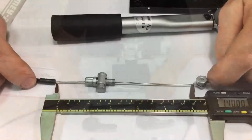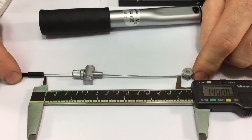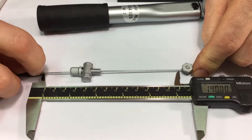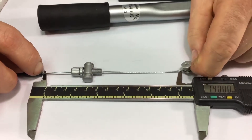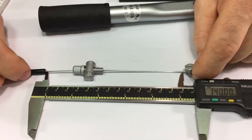For the three-speed, the cable adjustment for the rotary shift three-speeds is 140 millimeters. Measure from the tip of the ferrule, making sure that the ferrules are seated to the inside face of the cable anchor. It should be exactly 140 millimeters.